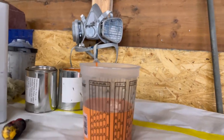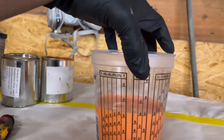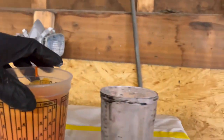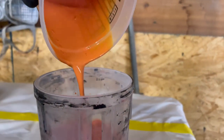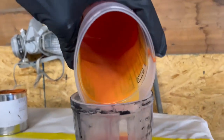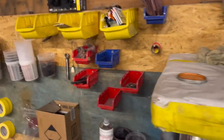If you want to save paint and stretch it as best as you can, use one-to-one. But if you've got enough paint and you really want it to cover well, use two-to-one — it's just thicker. Give it a little swirl and let that pure paint at the bottom settle down a bit.